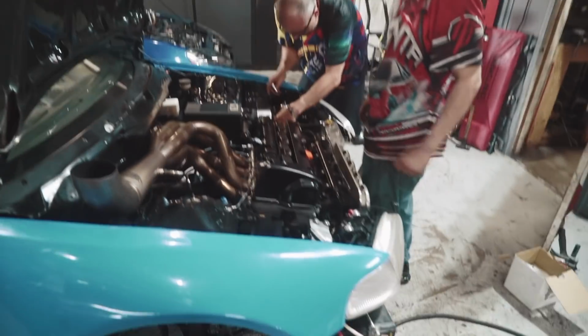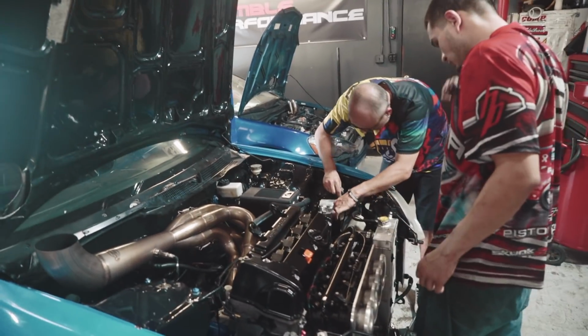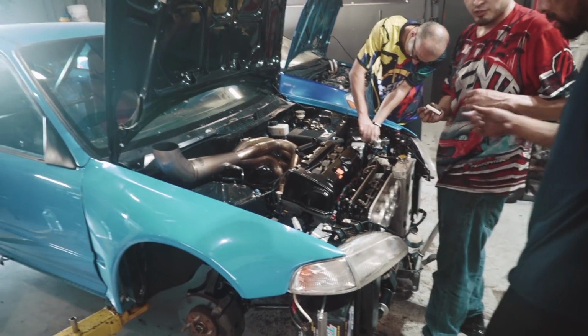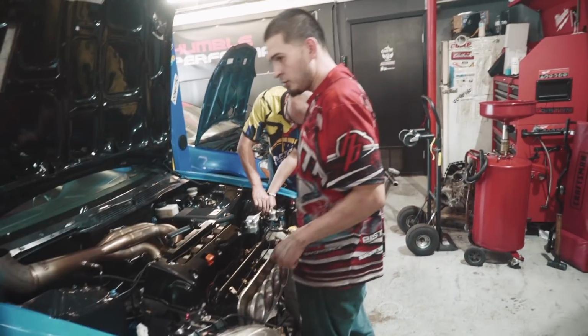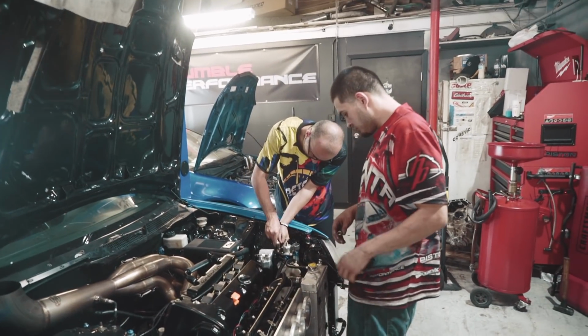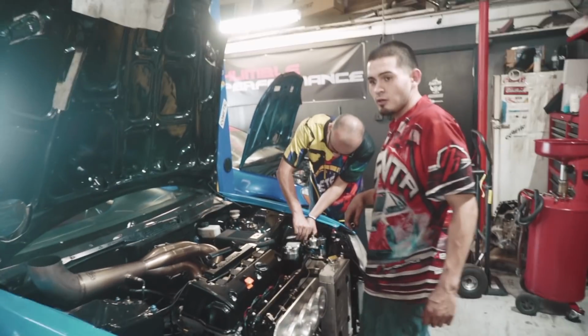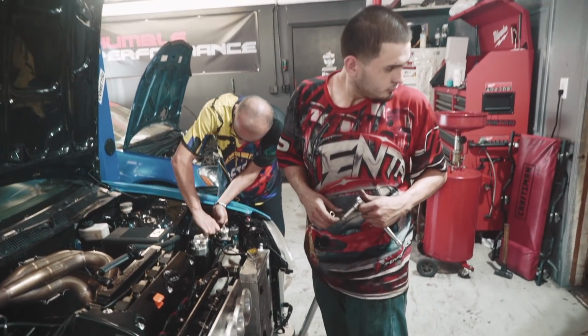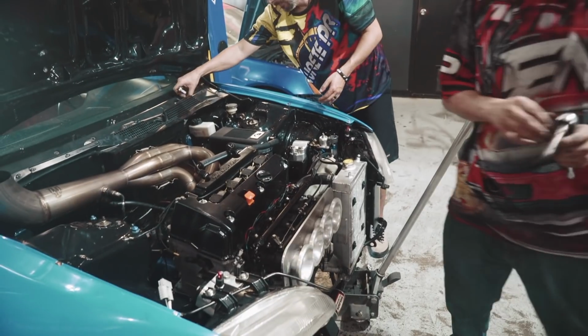So we've gone ahead earlier today, Bolo and Kenny, Alex and Paulo pulled the trans out of Blong's car. It was popping out of second gear on the dyno. Turns out it was a bent shifter rod, the mechanism. It happens really, really occasionally on these dog box motors in the K-series if it locks out of second or third. So transmission's rebuilt, ready to go.